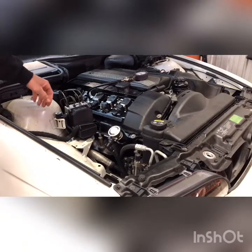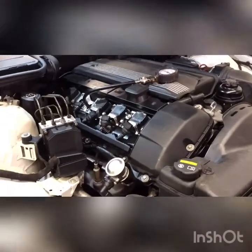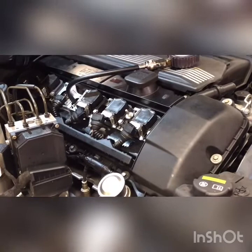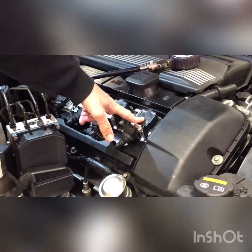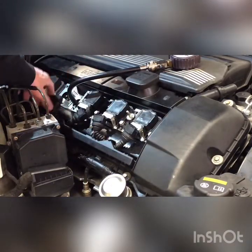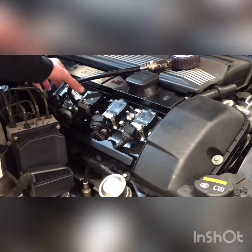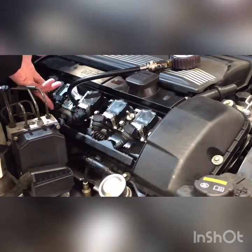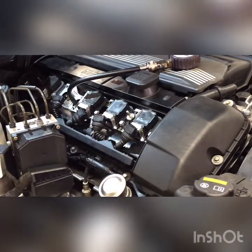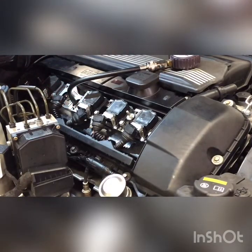We started out with our coils first — zoom in here. Once we got that big cover off the engine, we swapped out coils. My problem is cylinder number four. So first thing I did was remove the coils, swapped coil four and three, flipped them around, put them back in. Code came back same — cylinder four misfire.